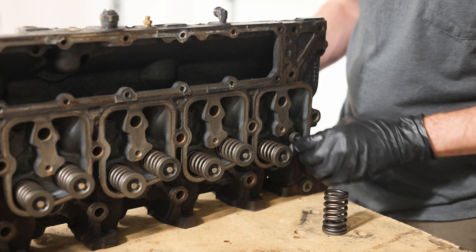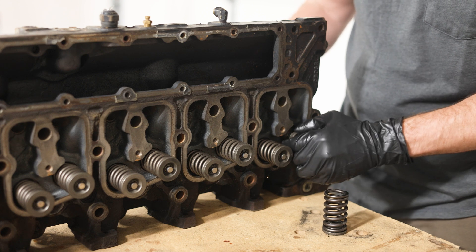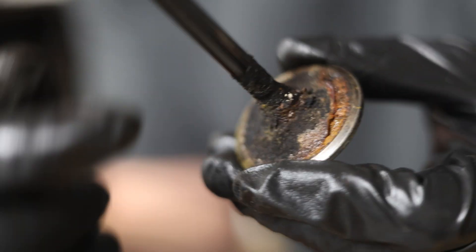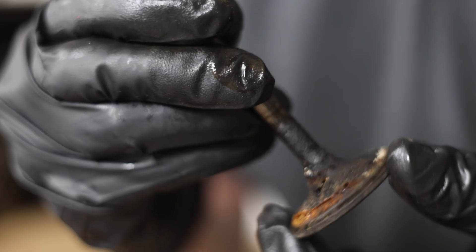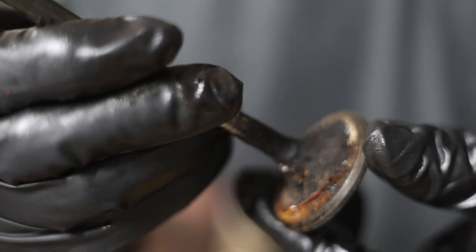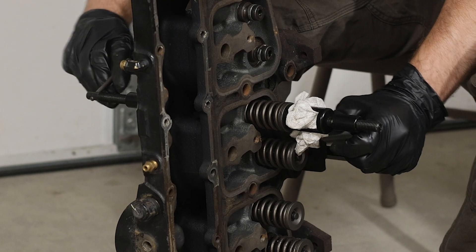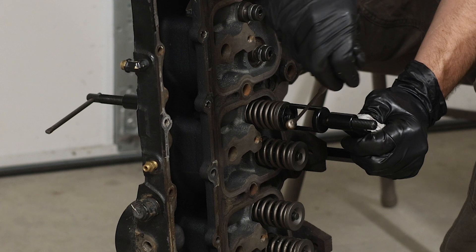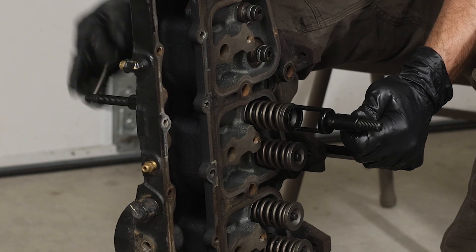We'll keep these all in the same positions. Here's our valve stem seal — we're going to replace all those because they came in the kit. It's a good opportunity to do this whenever you're into your head. Here we can see the back of the valve; this one's in pretty gnarly shape — we're going to have to clean this up. This will be a good opportunity to lap your valves, have them machined, and make sure everything seals correctly. The face of the valve is not in great condition. We might look at lapping these by hand, but for a budget build, we're going to see if we can make this work. I chose to do the valve spring removal in an unconventional position. Using a magnet to remove the keepers from the little window in the valve spring compressor — but it'd be much easier to just do this standing straight up on a bench.